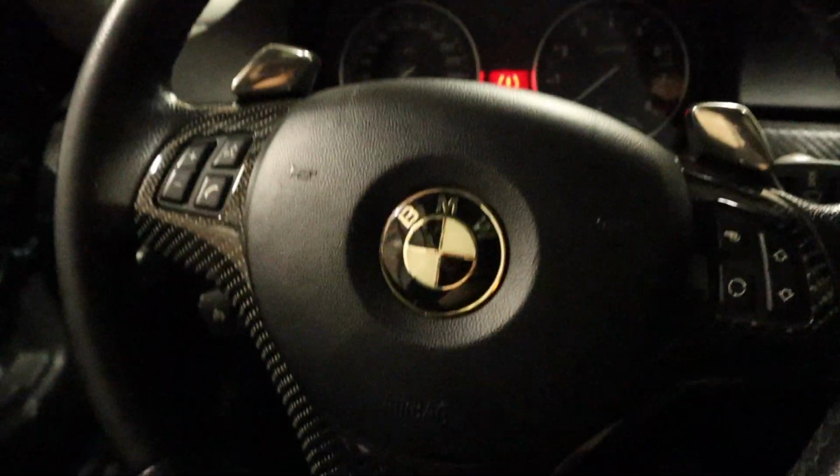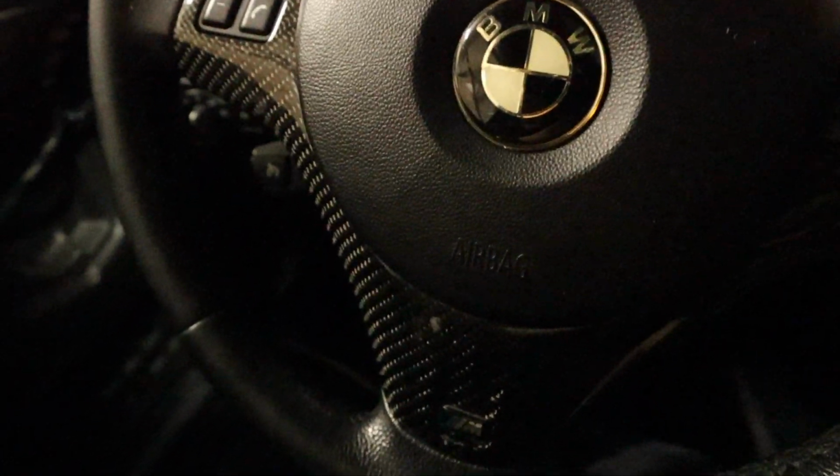As you can see, here we go. Now it says 0%. Wow, 1 minute left already. So it's going to be fairly quick. Success. So turn off ignition and wait 30 seconds. So we're going to turn off the ignition and count to 30 seconds. We wait 30 seconds, make sure the car is in neutral, and we're going to fire right back up.